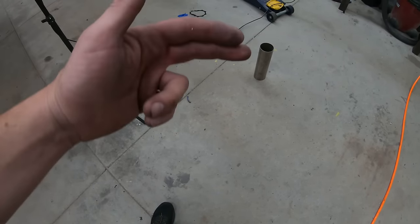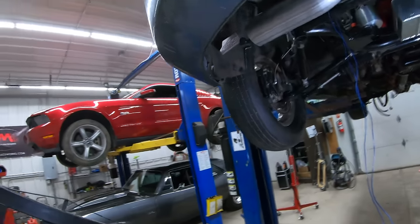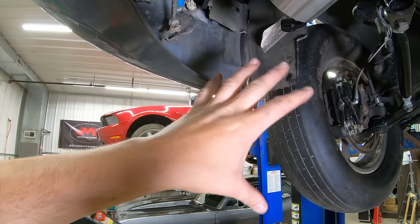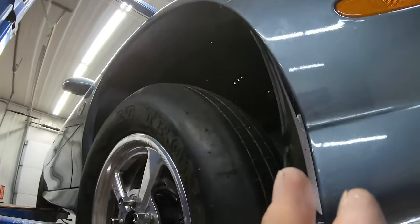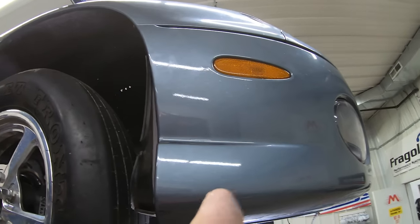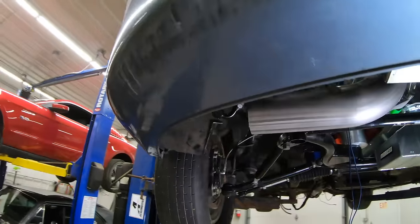It's nice to sneak up on it so you can make fine adjustments. If you make it smaller and miss, you'll see where you hit and can massage it to the right size — that gives you a little room for error. I'll line this up to make sure it's right, then slowly drill the pilot hole from the back going outward. Then I'll tape the fender on the outside and use the pilot hole to drill from the outside in, because it's easier to keep the paint from chipping going that direction.